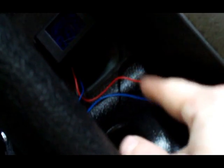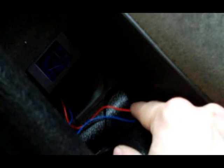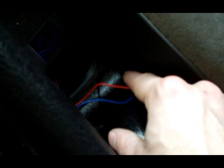Okay. It's kind of dark in the old Civic because I got it under the carport, but this is a pretty simple install. Here again, you have a red, the black one's hiding down there, same size as these: a red, black, and a blue. Power, ground, and remote. All you do to hook this to your amp, or you can hook it to your battery, it doesn't matter, is splice the red wire in with the power cord on the amp. You just stick it in your amp terminal with your power. Same with the ground. That way, these wires will read what voltage your amp is seeing.